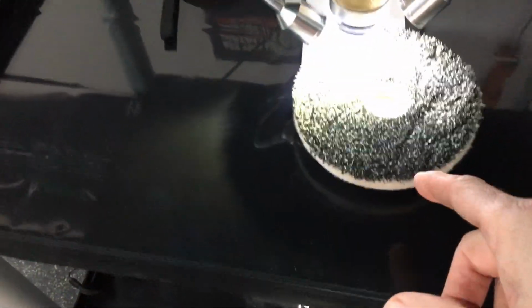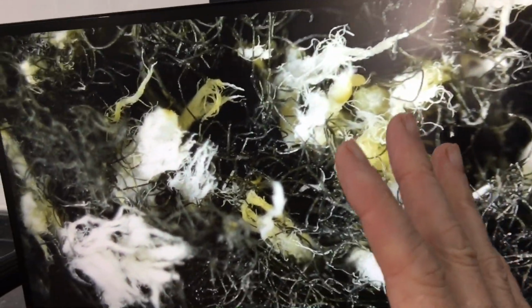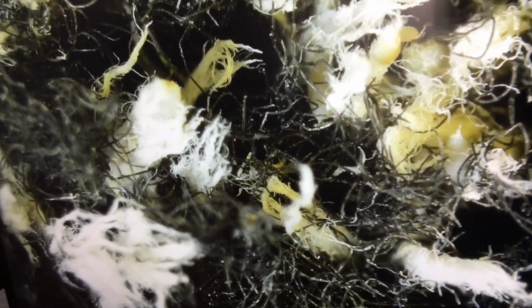When it comes to the Eurofiber 50/50 pad, when we look at that up close, what I did here was I just blew out the pad with no pad cleaner, no chemical, and you can see, now it did separate the fibers, decent job, but it's still pretty grainy, each fiber. By the way, the black fibers are the polishing fibers, the white are the cutting, and as you can see, it's still quite a bit grainy, so if you added a pad cleaner and then blew it out, it would really prepare the pad for the next round.